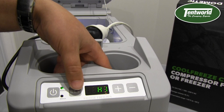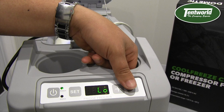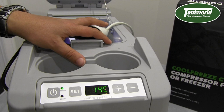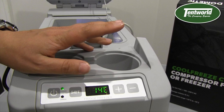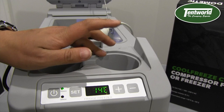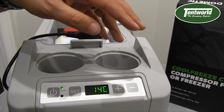The next setting is your battery voltage selector, with options of low, medium, and high. Low is if you've got a dual battery system where the fridge's main priority is running — not starting a vehicle. If your priority is keeping food cold and you have a second battery, always choose low. If you need to be able to start your car and don't have a dual battery system, choose high. Medium is a safe voltage for starting your vehicle and a suitable choice for day tripping, stopping for a few hours here and there — it means your fridge continues to run no matter what. Choose the right setting depending on your vehicle and battery setup.